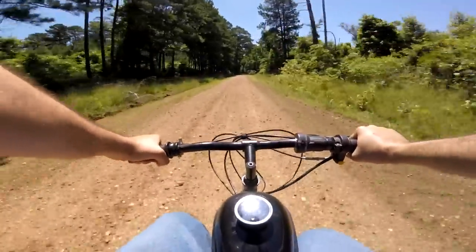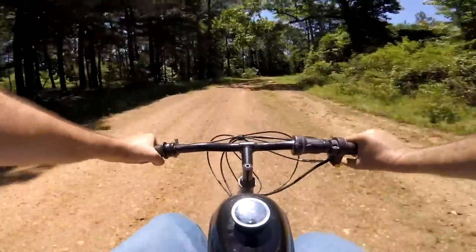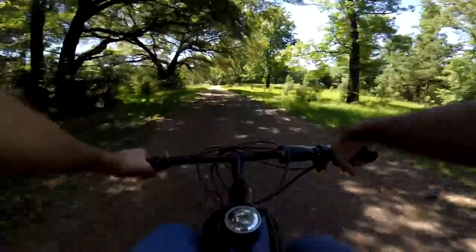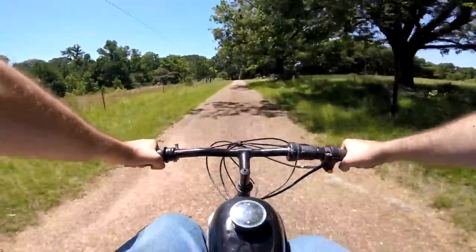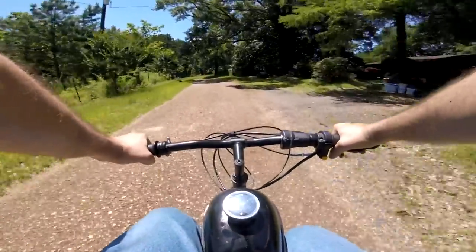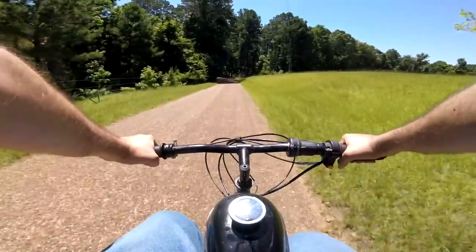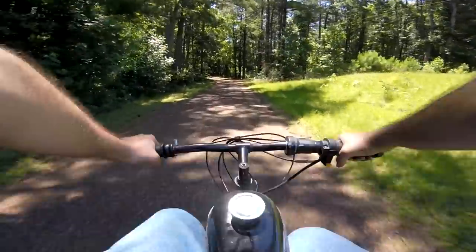The main reason I took this air box off is because I don't like the stock box that comes with the YD100 — it's a scoop design. The older designs suck in air from the bottom; this sucks in air from the front of the motor, which means all the dust getting flicked up from the front tire is sucked straight into the carburetor, and the air itself is heated from the heat of the motor. I'm going to try and rig up one of the old-style stock air boxes and just open it up a lot more. I also need to get some fenders on this bike. So that's where we are at the moment — 42 miles an hour with the air box removed.